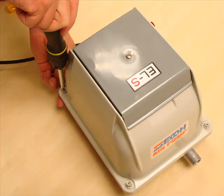And you're done. Check the pump starts. If it doesn't, you'll need to take the power supply back off and go back a few steps to gain access to the auto stopper switch, as it's quite likely to be the culprit if the pump doesn't restart.